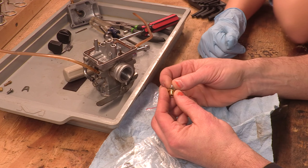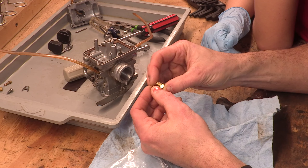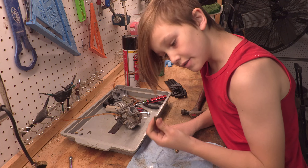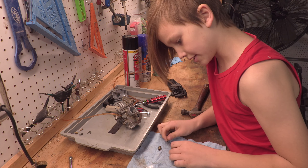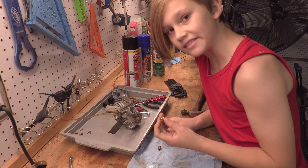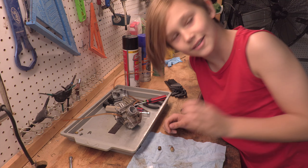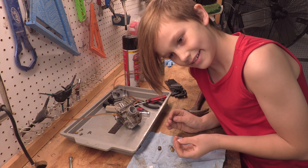This is the new float, but we really want the new seat. They sent us a kit that rebuilds a different carburetor. This is the piece that goes to my carburetor that the float sits in, and this is the piece they sent us — these pieces aren't the same. So we need to order a different kit. We'll pick up here in a second.